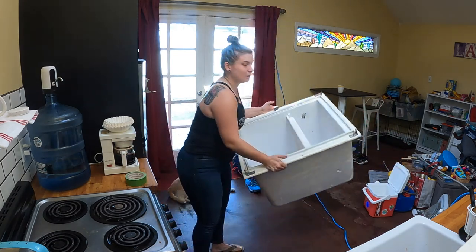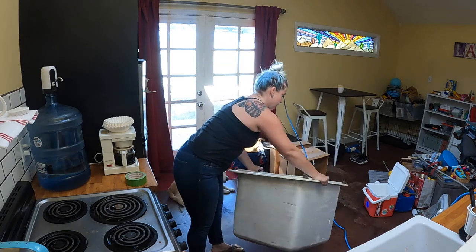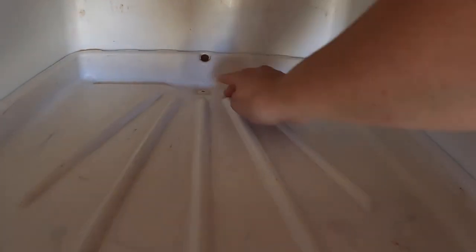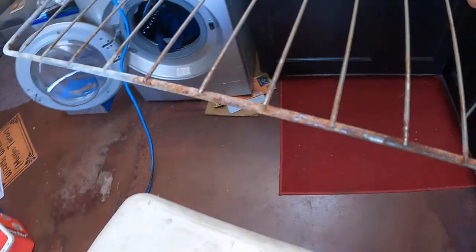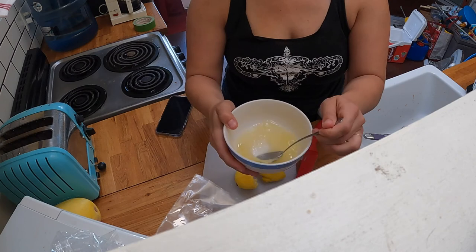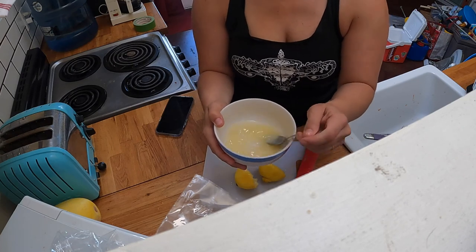While Erica is sanding the interior of Wendy, I am taking on the icebox. It is literally a cooler wrapped in styrofoam — so basic, but it is actually surprisingly effective. When we pulled out the icebox, we noticed that there was some rust inside. This is where you put the ice and it's slanted so that it will fall down here, down through. There's a tube that usually goes right here and out of the camper. So here's a little trick if you want to remove some rust — you only need two things: lemon and salt.